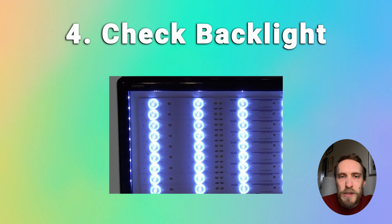It's important that you make sure that all power is drained from your TV before you take it apart. So remove the plug from the wall socket, hold down the power button for 10 or 15 seconds, and then leave it for 30 minutes or so, just to make sure all the power has drained from the capacitors, because you don't want to get an electric shock when you open the TV.